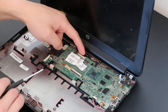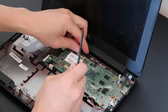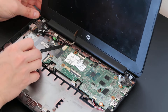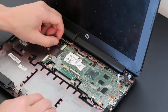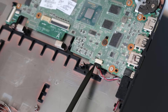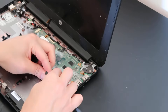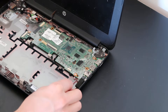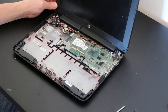For the motherboard: your LCD cable comes down here and plugs in at the back — same ZIF connection as before. Pop it up, slide it out, snap it back down. Your power jack plugs in right here using the same plug-style connector as the battery, so put two fingernails there and slide it out. The speaker wire is a bit more annoying — it's not the ZIF clip or the battery plug type. It takes some extra wiggling since there's no space for fingernails, but resist the urge to pull on the wires.